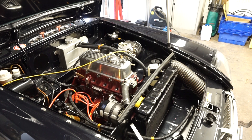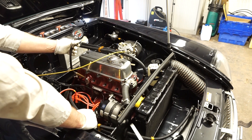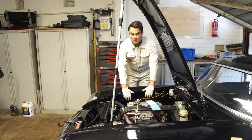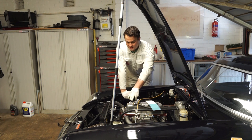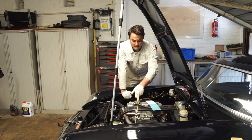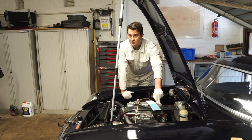Let's see the reading for four. Number four is 200 psi. So with cylinder four done that's the test completed. Cylinder one is 210 psi, cylinder two is 200 psi, 210 psi in three, and then 200 psi in four.